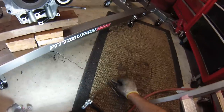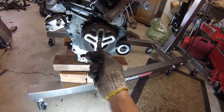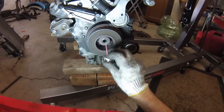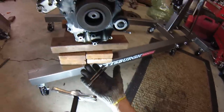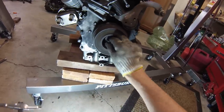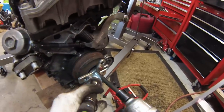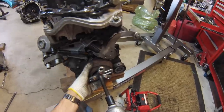Next I'll take off the crankshaft pulley here. The way I do this is with a steering wheel puller type of tool. There are a couple of really small threaded holes — I believe this is a 6mm hole — and the bolts are about 40mm long. If I use it just as-is, the center bolt will actually press on the crankshaft itself. So what I do is use some old head bolts that I cut to different lengths, stick them into the hole, and that way the tool will press on the bolt instead of the pulley. I'll keep an eye on the tool to make sure I'm not bottoming out on the pulley — if I do, it'll snap off these bolts. This goes in clockwise of course.